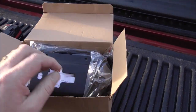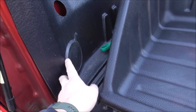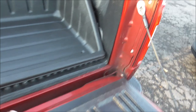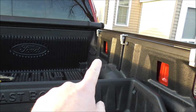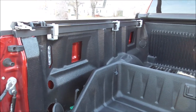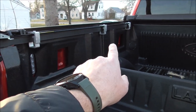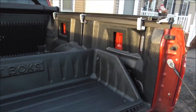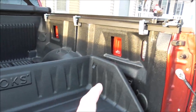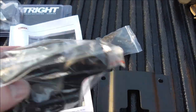But this is what we're working on today guys — these are tie downs that you can put in the back of your truck. This truck comes factory with tie down anchors: one in that corner, one in this corner, one right up there, and one right there. I want to be able to tie down into some other locations, so they make a factory option that goes here and here and another one here and here. That's what I have today — these brackets screw right into those factory locations and they have little T-handle pieces that hook in, and they come with actual locks.